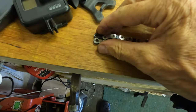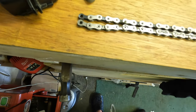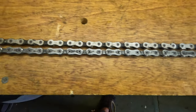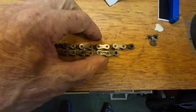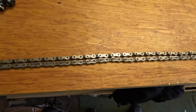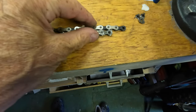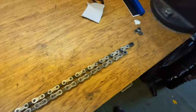So here we go — top chain is brand new, bottom chain is the old three-year-old one. If you put worn chains next to new ones, a worn one will start to measure longer due to wear in the links. We'll put these two level — dead level at the start. Go through and you should see the bottom start to get longer. Can you see it? No — in fact there's barely any difference at all. This chain hasn't grown at all. I struggled the first time I did this, I was shocked — you'd think that bottom chain was new. It's not. It's the hollow-pinned XDR chain I originally put on. It hasn't grown.